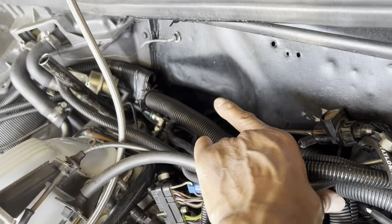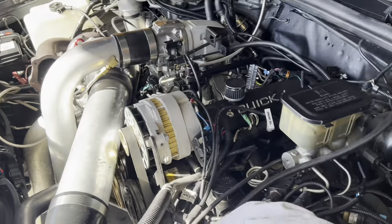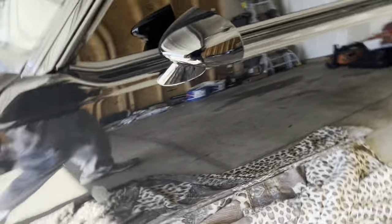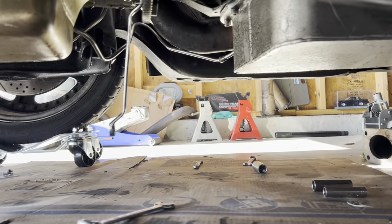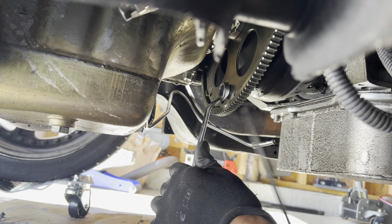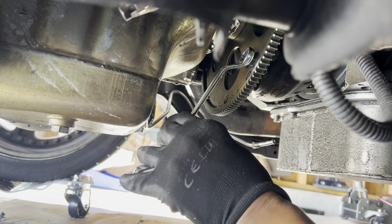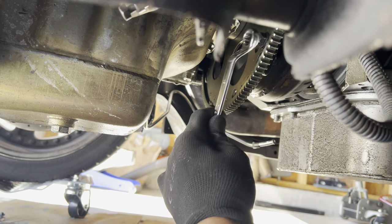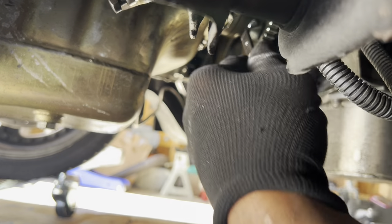The hardest part was trying to find something to get that one bolt out over here. Like I said, I'm limited on tools. So I got it out. Now underneath here I'm going to try to get the torque converter bolts out. It's a 15 millimeter and I've got my screwdriver here. Hopefully I can keep it from rotating as I loosen that. Oh my God, that thing was on there good.